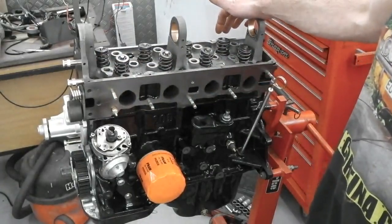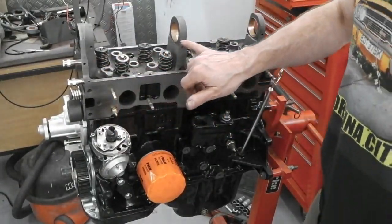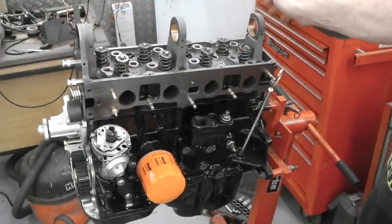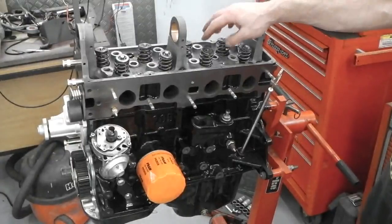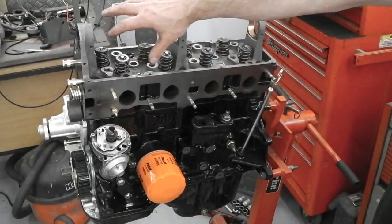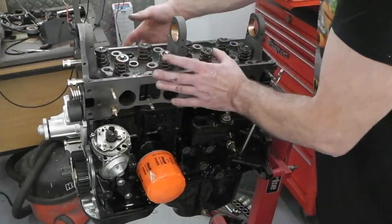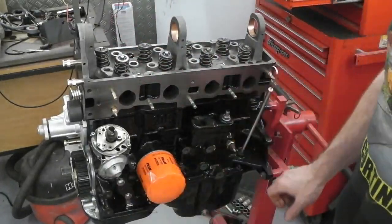So effectively speaking, we're just looking for oil coming out of the galleys in the cam towers, with the new shells in the cam towers. We can slide the cam in, I think. I don't think not having the ball studs in at this point makes any difference, but I can always check on that. And then we can work on this area before we put the manifold on. It's easy to set the cam timing up and everything while we can get round it at this stage. Yes, fit these items, but that's about it.